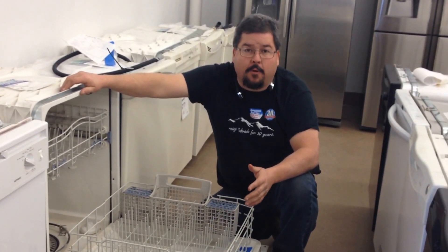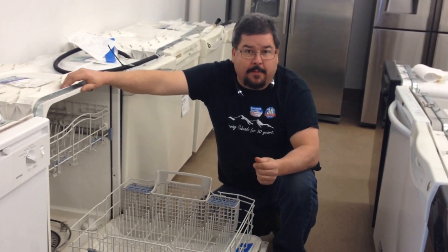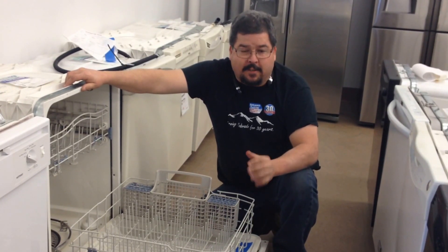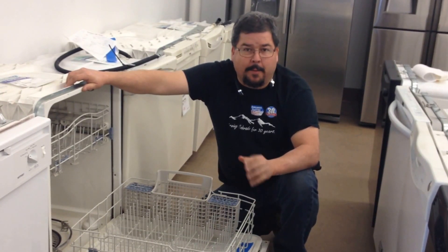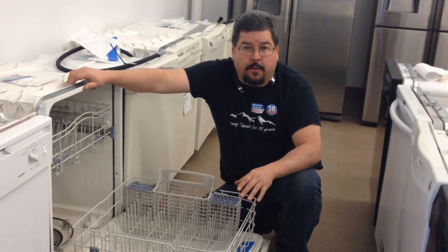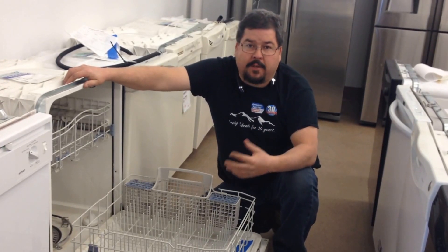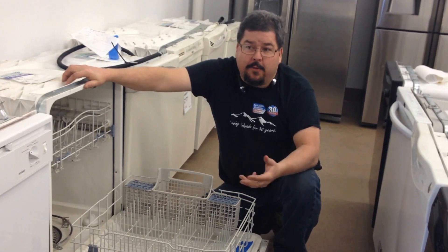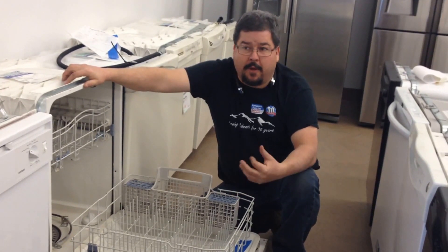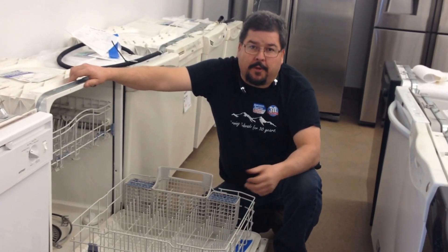A lot of areas have hard water. If you've ever noticed that white buildup on the inside of your machine or on top of your glasses, that's hard water — that's not dirty dishes. It's still safe to drink and it won't hurt you, but if you don't clean your washer, it's only going to get worse. So basically, once every couple of weeks to every couple of months, run a cleaner through it. If you know you have hard water, you'll want to clean your washer more often than if you don't.